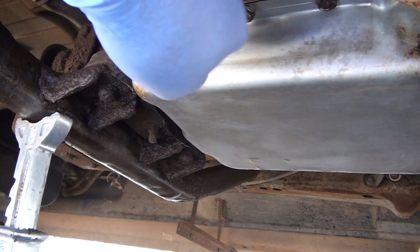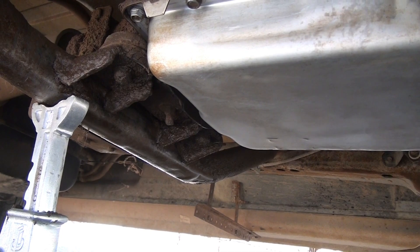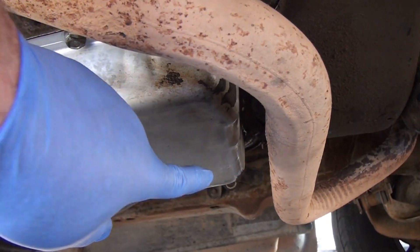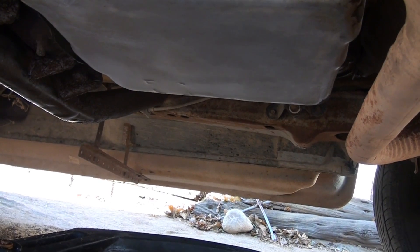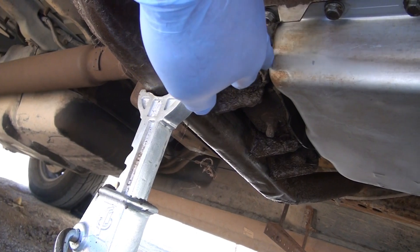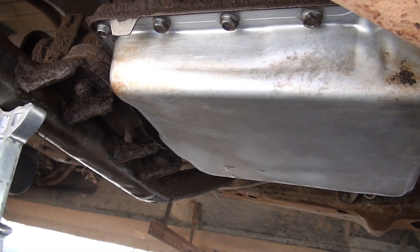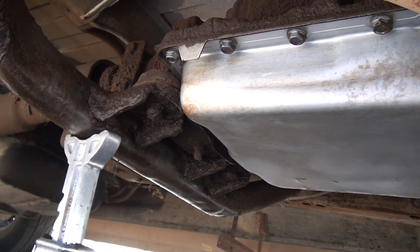I need to remove the bolts down this side here and on the other side. Now this is a little unusual — usually drop the pan from the back. But I said leave the bolts here and remove the bolts from the front, drop it down that way. Probably because of the brace that's across here — there's not a lot of room and when you go to drop it down it's going to hit. So let's hope there's enough room for it to clear the exhaust pipe. The bolts look like they're a 13, and I'll start on the other side because it's not wet over there yet.